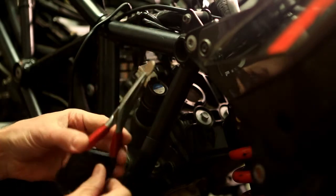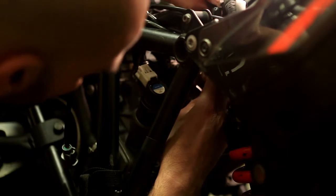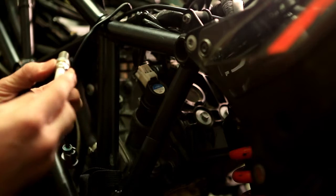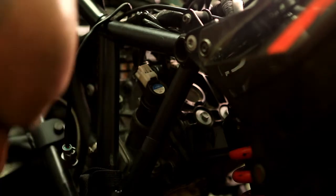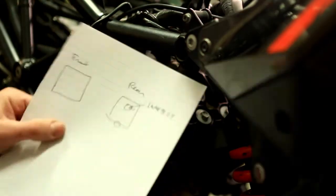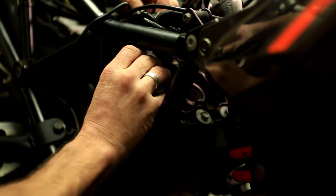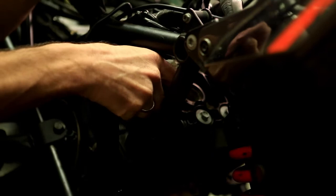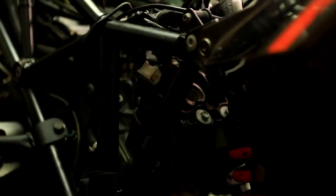It's a long thread so just take your time. I didn't have a proper magnet tool so I went a bit DIY and made one held by a plier. Because you've got two different types of plugs on the bike, make sure you take note of which one is which so when it comes to putting them back in you won't make a mistake. Take out the second connector and the second ignition coil.